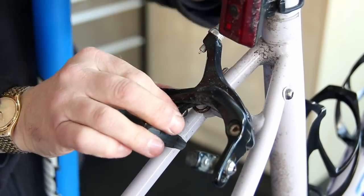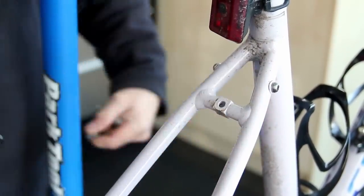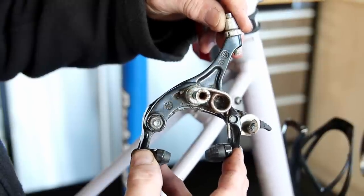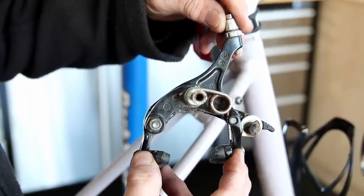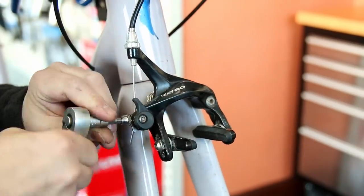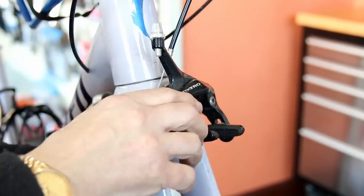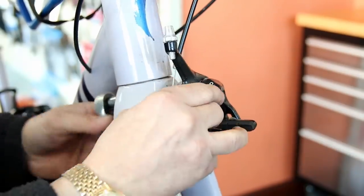We're going to change the rear cable - you can see it was frayed off at the pinch bolt. Obviously that one was also sticking; you can see the rust on the springs and pivot points, everything was a little bit corroded. We'll get that through the ultrasonic cleaner, re-lubricate it, and it freed up perfectly, so that was good to go again. That was a great result on that rear brake.